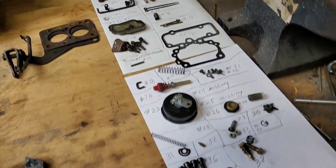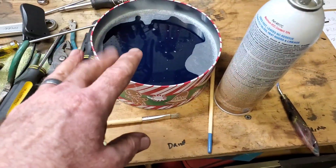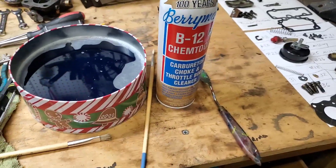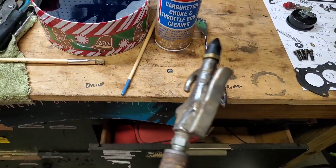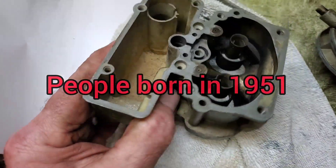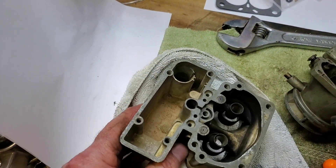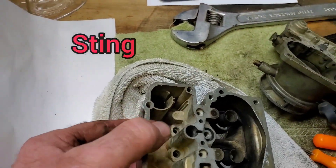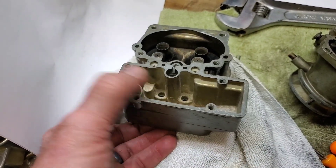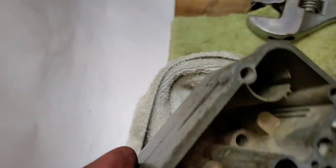Cleaning is what we're going to be up to for a while now. I've already cleaned the throttle body using a brush and a little Simple Green, spraying it in some of the passages and on the worse buildup, then using compressed air to blow out any of the passageways. Look at all the rust in that float bowl — that's from ethanol getting water in it and rusting out the gas tank. That's why this thing probably needed a whole new tank. I cannot believe they did that whole fuel system and yet didn't bother cleaning out this poor carburetor.